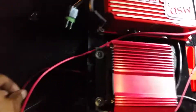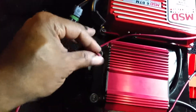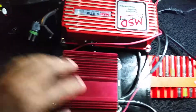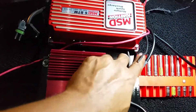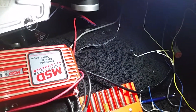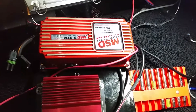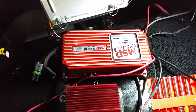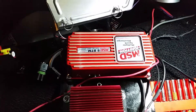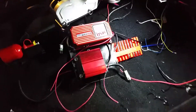This basically had an awful power feed — it was going to the solenoid sitting on the firewall that triggered the starter. It was on the constantly hot side of the solenoid, and this ground wire was connected through that harness to the frame rail. The car will never run right like that. You've got to remember, if MSD says to put it to the battery, there's a reason they tell you that — because if you don't do it, it probably won't work right.